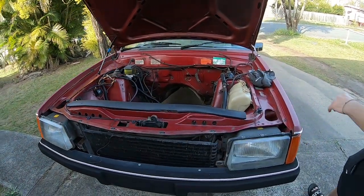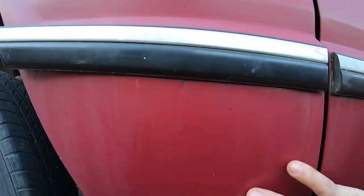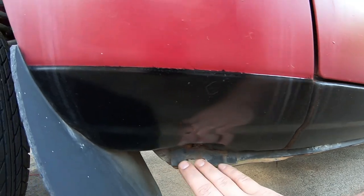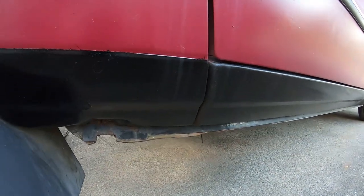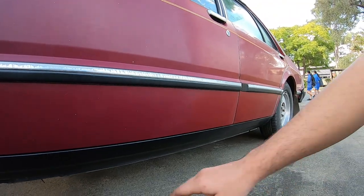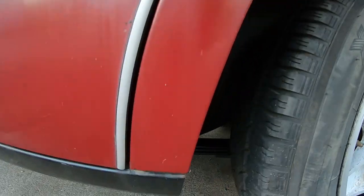So to summarise — we've checked the roof, the doors, the front. Obviously you're doing both sides, the seals. Very common in the front guards here — they can rust out lower. This one is absolutely mint; there's a bit of a dent there, but a dent can't be bog because it's steel. If you get in from the other side, looking back on the panel — check the inner seal. Get your eye alignment up nice and close with the panel and look down — it's basically mint. Come through all the doors.